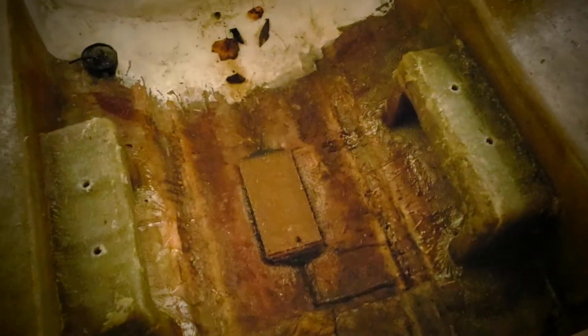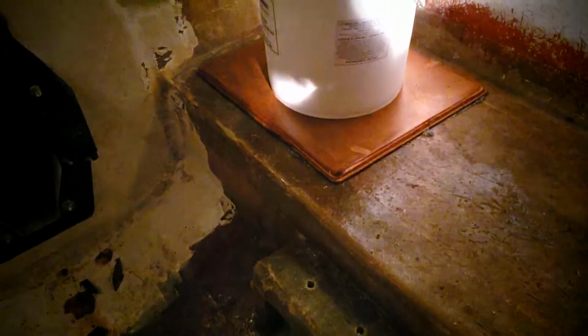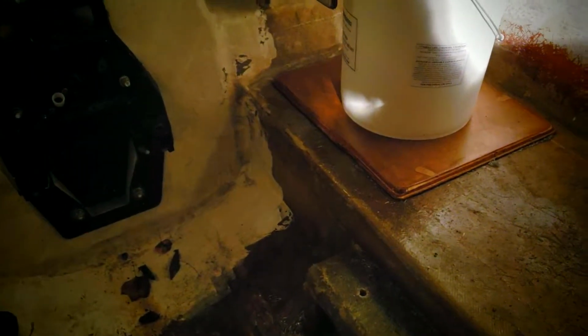Once I get these glass in and everything, I'm going to come back here and do a quick sanding on the back. And I think I'm going to go ahead and gel coat the whole engine compartment area in, so I can just get the motor in and call the back basically done. And then I'll move on to the front and start doing the fairing on the floor and stuff like that. So yeah, we're getting close to having the engine in for good. That's where I'm at. I'll let this thing set up, get the CSM on, and show you what that looks like.